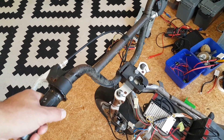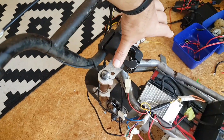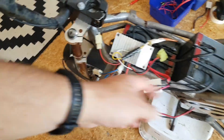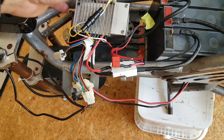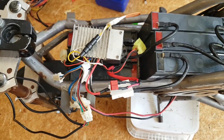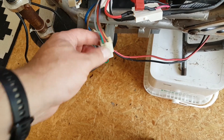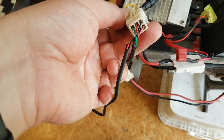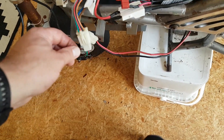Okay, so another problem I have — because they put these BMX handlebars on here, which is probably good because my kids are getting a bit big for this — the cables are quite short. Originally the speed controller goes under the seat, but it won't reach there anymore because the cable is going up this extra length. So it's a bit dodgy putting it down like that. Eventually what I might do is extend the wires — just splice these and solder a longer length onto it.